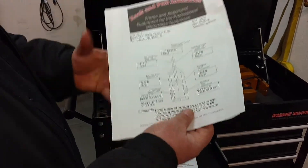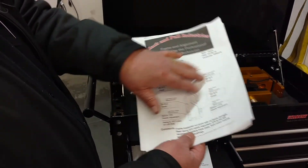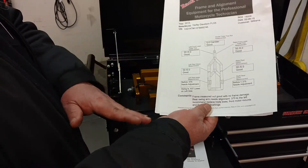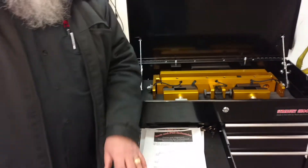It'll show for your customers — it'll validate that the frame is good from the factory, all the frame is straight, but the swing arm is off to the left, and the lasers show that the swing arm is down on the left side as well. That causes a handling issue.